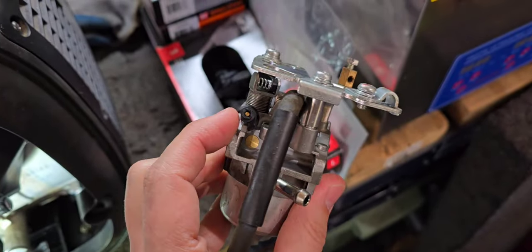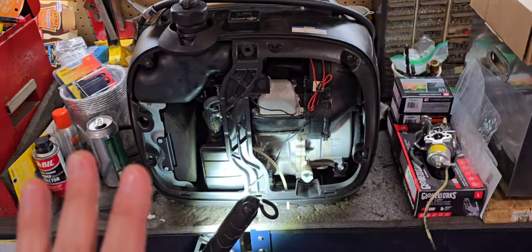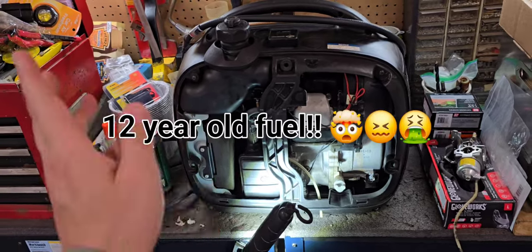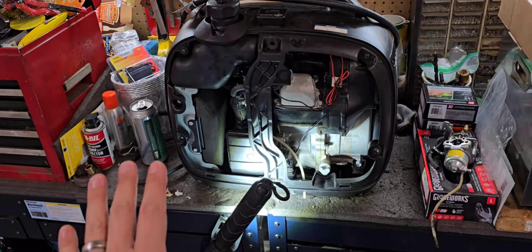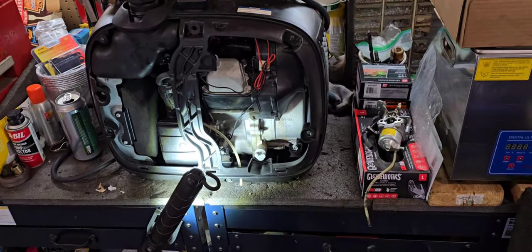Very similar to how the motor snorkel is. Basically what he wanted me to do was not only to clean it up really nice, but drain the 8 or 9 year old fuel that smelled terrible like paint varnish, clean that out and get it running. Then I asked him, well, what do you want to do? Because there's nothing wrong with that drilled out carburetor.